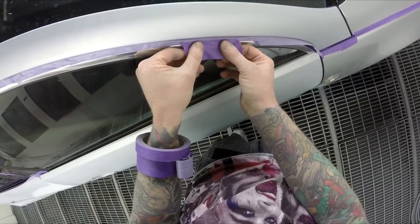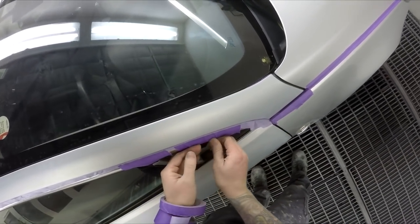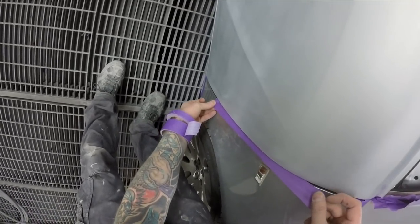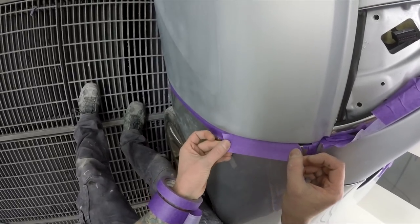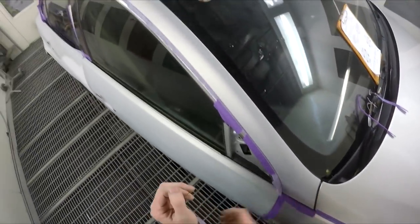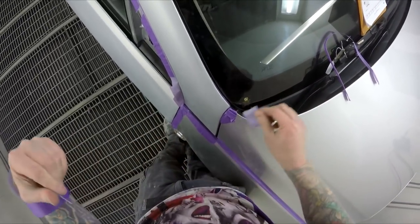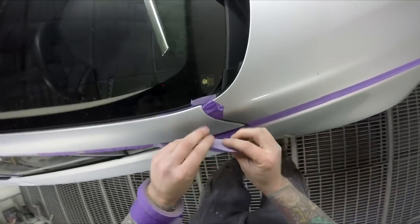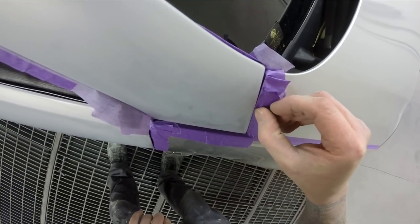I did a video on how to spray over chrome ages ago when I had my own workshop. The only way I could think to get paint to stick to chrome even for a short time would be to use epoxy. Someone was trying to tell me you can't use epoxy, saying I need to do some research. I've always associated epoxy with restoration work, so I asked my mate Jose from Gator Negro Body Shop — he's got an awesome resto shop in the Netherlands — and he said yeah, he uses epoxy all the time because it sticks to anything and you've got your rust inhibitors inside it as well.